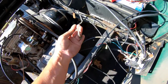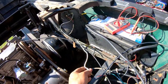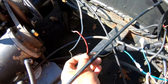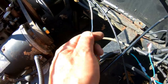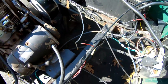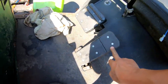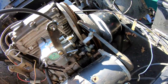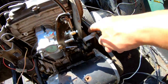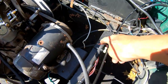The problem is figuring out where that wire leads. I've got a wire leading to the fuse box, which I tested — it has no power. The only one with power right now is this wire here, which I multi-metered and it has a constant 12 volts. But do you want constant power to this, or only power when you step on the accelerator? The pedal moves when you step on it but doesn't return. I'm going to try running a wire from that constant power source to this ignition coil wire to see if I can get spark.